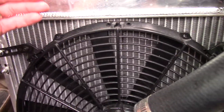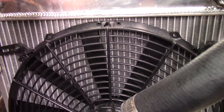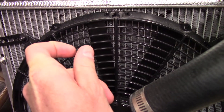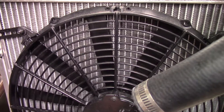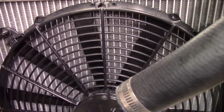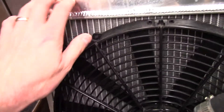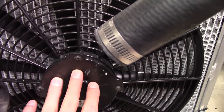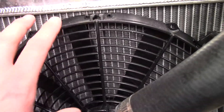You can have a 2,000 CFM fan that does not perform as well on your radiator as a 1,500 CFM fan, because the performance curve will not be as good. If it's a cheap electric fan rated at 2,000 CFM, the second you put it in front of seven or eight millimeters of water column — which is about what this two-core radiator is with its fin spacing — the performance curve of this fan on this thinner radiator is going to be much better than it would be if it were thicker.